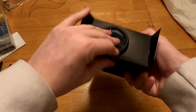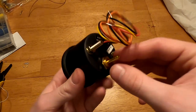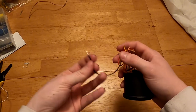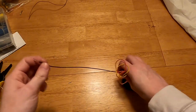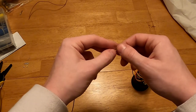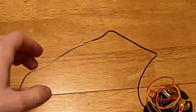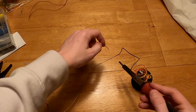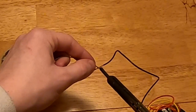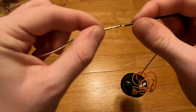The first thing I'm going to do is take the gauge out of the box. There's the gauge — you can see the wires. It's a mechanical gauge, so you actually have to run a boost line from the engine bay into the car. But first I'm going to extend these wires because they're only about a foot long and we need longer than that. So I'm going to solder them together with much longer wire. You can see it's got a pretty nice solder joint on there — it's nice and strong.